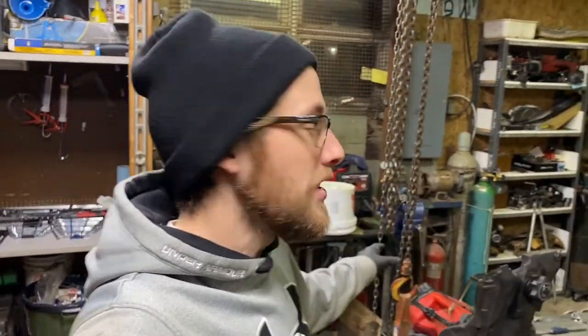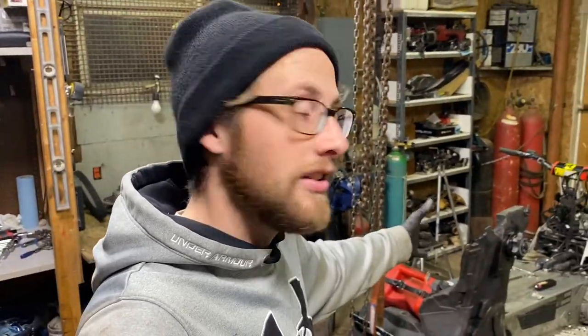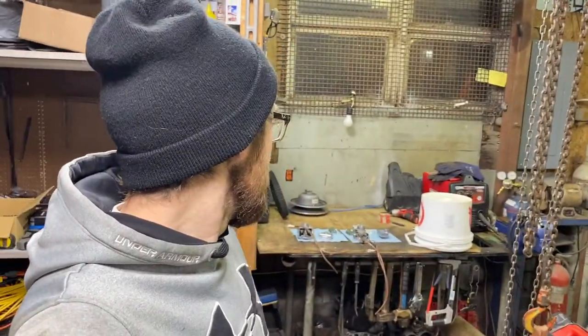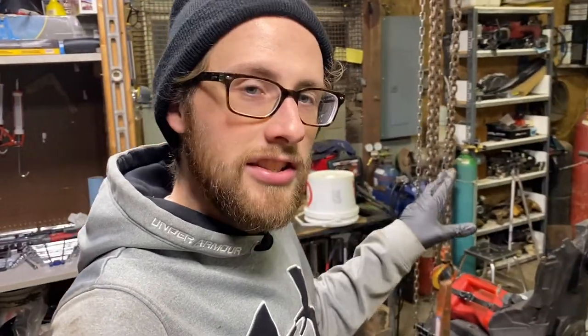That's all I'm doing on the sled with the fuel system. We checked the carbs, we're going to hard jet them, the fuel pump looks pretty good with no damage or debris, the fuel tank looks perfect, and we're going to get rid of that fuel sight line - apparently a really common problem that guys delete on the forums and say it fixed their issues. Unfortunately we did a bunch of stuff here so we won't know the exact cause if it gets fixed, but it'd be funny if it was just the little fuel sight line. I also hope these issues didn't cause something bigger. We're rejetting now, so we want to make sure it's not too lean or too rich - don't want to burn a cylinder or be changing plugs every 15 minutes. Hopefully we get some testing done and I'll bring you guys along for the first rides.